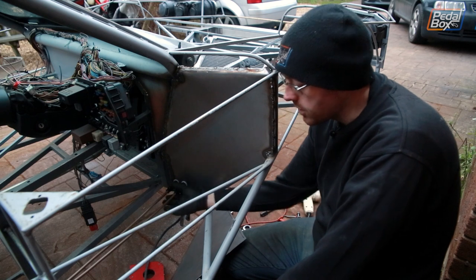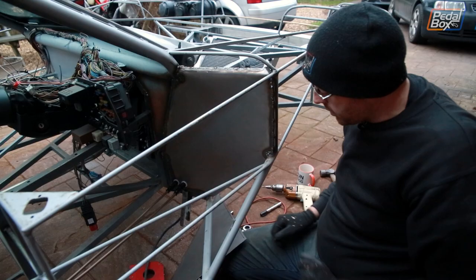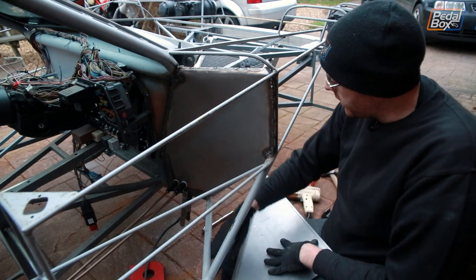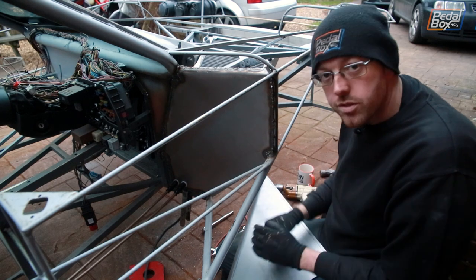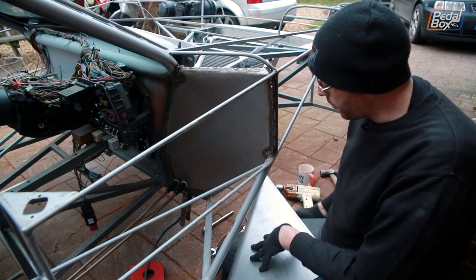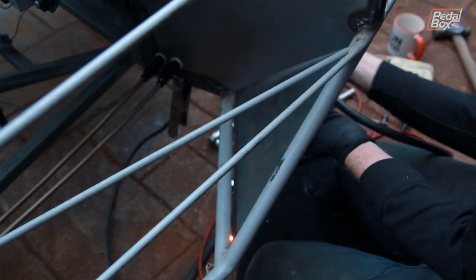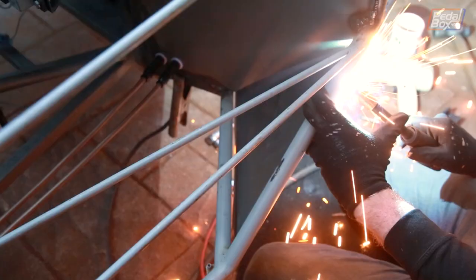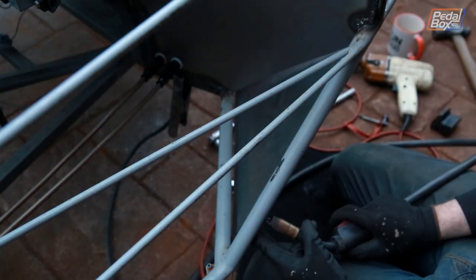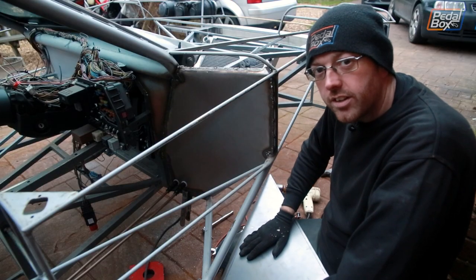Once the holes are drilled and I've fitted the bulkhead adapters and attached the two lines from the rear all the way up to this side, I've also gone around and welded all of the seam in around here. The last one to do is to join onto this plate which is going to sit under this side. This is going to be metal because it's probably going to get hit with a lot of stones and rocks, and I don't want it to break easily, so it's going to be backed with some steel. It'll also have lining around the inside so it won't get punctured — there's one of these going on each side.